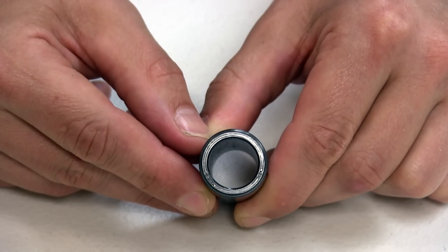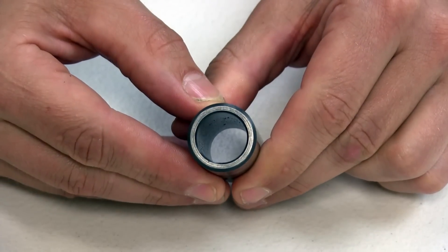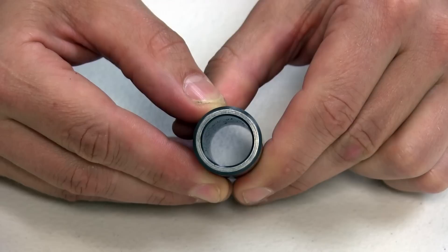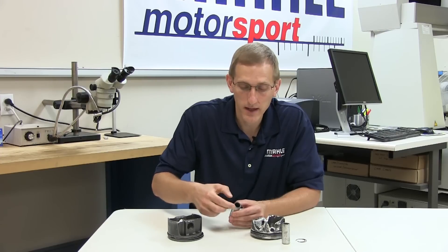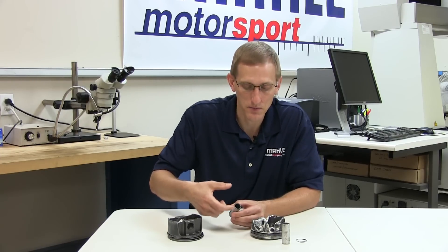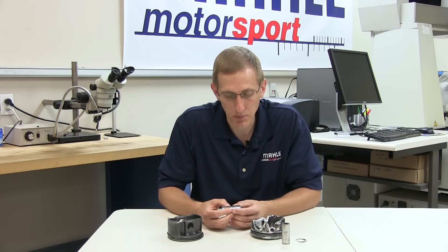In this particular case we have a concentric mark on one side and almost no mark — or a very small diameter witness mark — on the other, indicating that that clip hadn't been fully seated into the groove. The smaller diameter of the witness mark shows us that the clip wasn't fully seated and was much more probable to be forced out through side force of the pin.